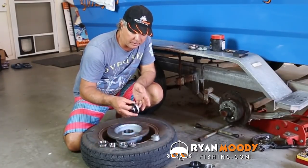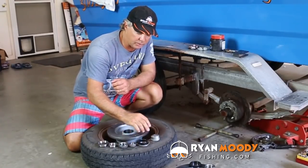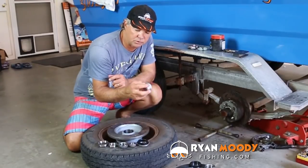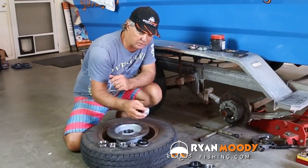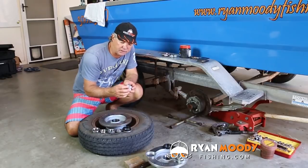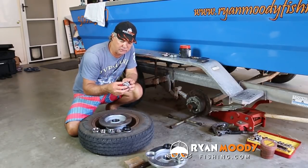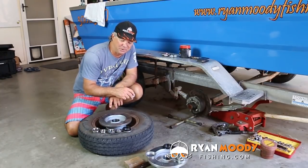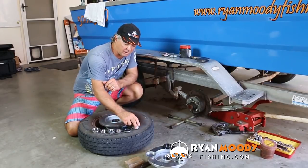And of course if it's a marinised bearing kit you'll have the seals for the rear as well, so you don't get water in there at the boat ramp. The cap that goes on the outside stops any water from getting in on the outside, keep that fairly packed with grease as well inside there. You can also buy these self-priming ones with the grease nipple on the end, they're 35 or 40 bucks each, but people pinch them off your trailer at the ramp so I don't really bother with it anymore. You can stick with the standard caps if you like.